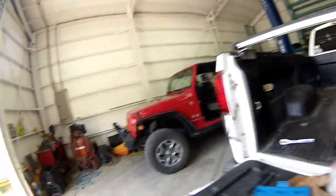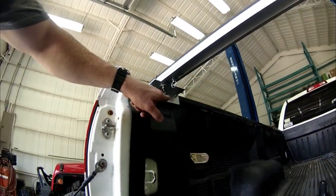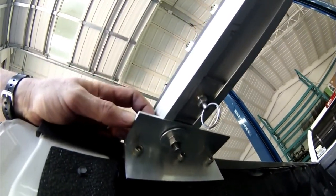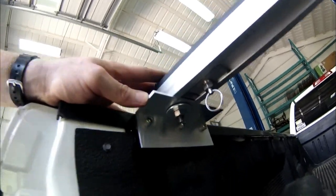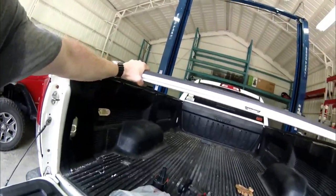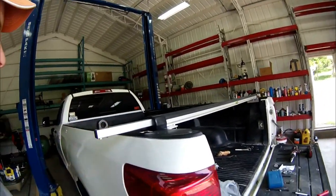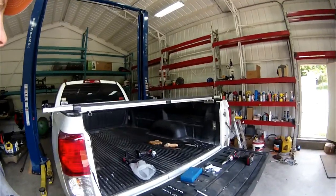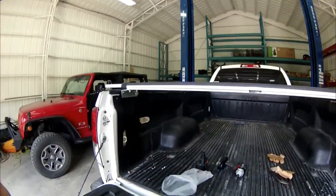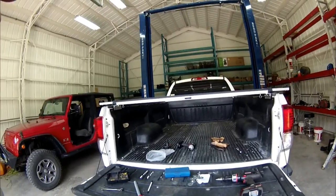I got this squared away at least for the back. I put three bolts through the angle iron piece with a big washer and a lock washer underneath — I might need to remove that, something doesn't look right. Then I drilled this so it'll allow me to extend it out and back. It's pretty solid — shaking the truck doing that. It should give me a pretty solid mounting point for the kayaks, definitely more secure than what I had planned originally. This way I can use the bed space for extra cargo and fishing gear so the kayaks aren't taking up the bed in the back.